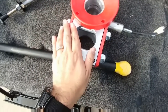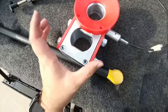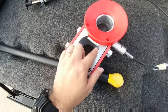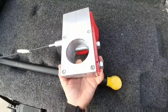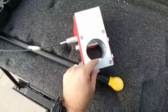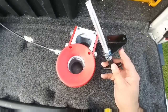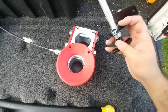I've removed the coupler attachment from the box to take a look at it — this thing's pretty cool. It has a cup that when it goes down over the ball, helps it slide in. This looks like that nylon material designed to be greaseless, essentially acting as a slick surface so the ball drops right into the hole. Here's how it actually attaches to the kingpin: you take these bolts out, slide it over the kingpin, put the screws back in, and it attaches in the groove on the kingpin itself. Then you have four set screws that you tighten, applying pressure against the bottom of the kingpin plate to keep it from moving. It's got a really nice release lever that lets you couple or decouple from your truck or trailer.